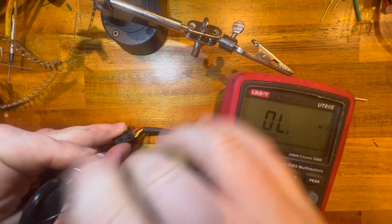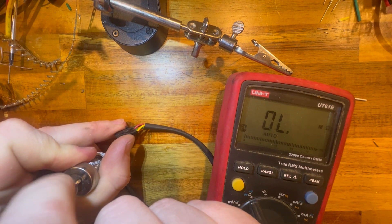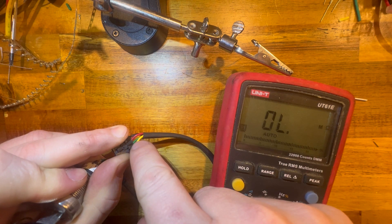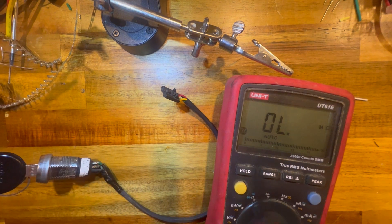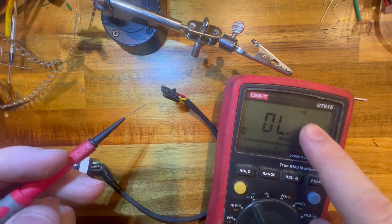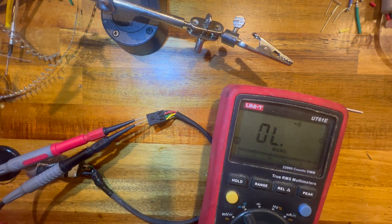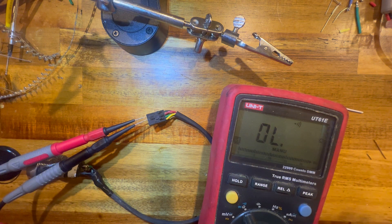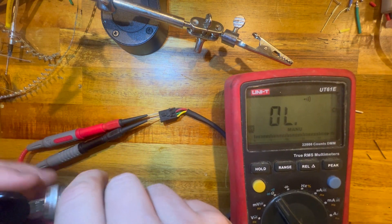When the key is switched to the right to the first position, that is turf mode, which limits speed to 15 miles an hour. Next is drive. So we have 12 volts, reverse, turf, and drive. To test this, we'll be in the key-off position. Put your meter into continuity mode. Put your first probe on the first pin and your second probe in the reverse pin. If you don't have skinny probes, find a little piece of wire you can insert in there and tape your normal probe to it, or buy some probes like this off Amazon for about $10.